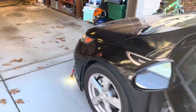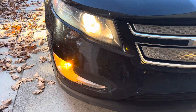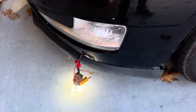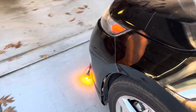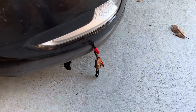The problem is in my 2014 Volt, if you turn on the blinker — I'll turn on the one I haven't fixed yet — it blinks three times slow and then goes to hyper blinking because the voltage or the amperage for the LED lights is too low. Over here, I've now put in the resistors so you can see this one is continuing to blink correctly.